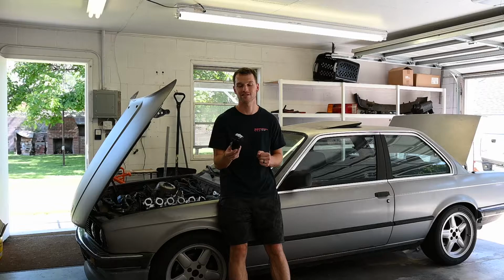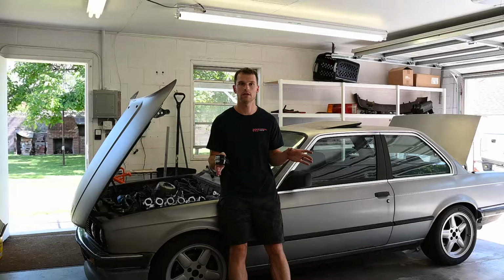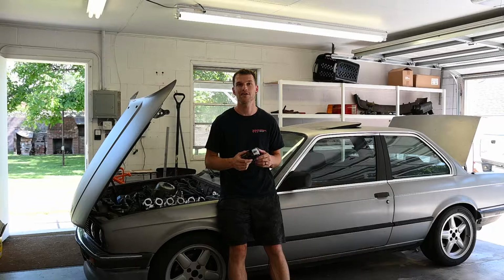It seems fairly straightforward. You start with the middle pair, and then once those are equal, which they should be, you move to either of the other two pairs, and then you just try to match the numbers that you get on the tool to the middle pair, adjusting the set screws as you go. Once I can finally figure out the issues with the throttle cable and making sure everything's set up properly, I'll really be able to get through the synchronization step, and then we should be able to take the car out for a drive.